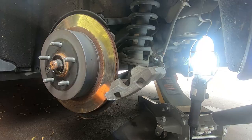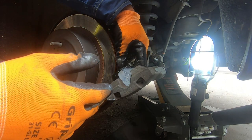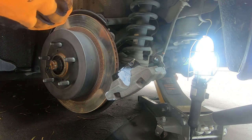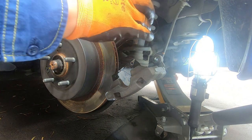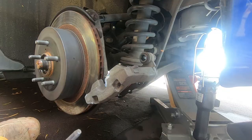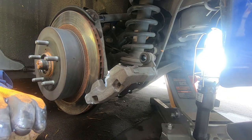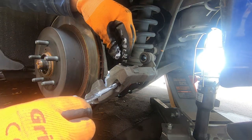That's all the way back in. Now we can put on our new brake pads and put our guide pins in as well — one on this side and one on the other side. They only go one way. Get our brake grease, put it on our guide pins — a nice amount — and we slide it in.